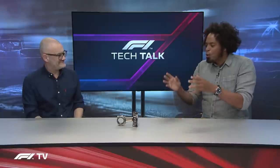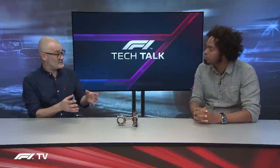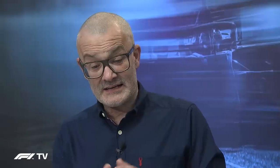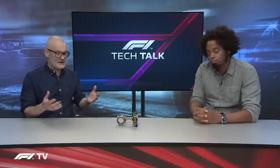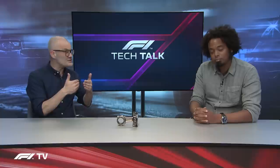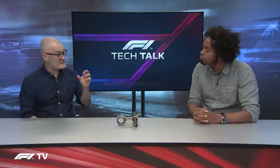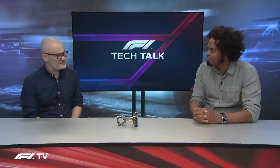Craig Scarborough joins us, and we've got a piston and conrod in front of us from a Formula One engine. It's from a Cosworth engine, going back to the V10/V8 days. What you'll notice compared to road cars, motorbikes, or two-stroke engines is the size — the piston is enormous in diameter but very shallow in depth, and equally the conrod is incredibly short. Both are very light, and it's remarkable to actually get your hands on something as exquisite as this.